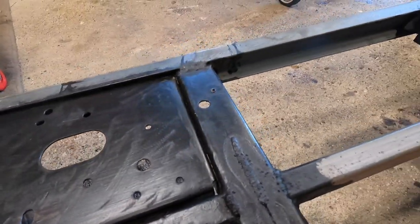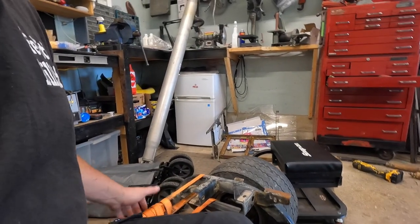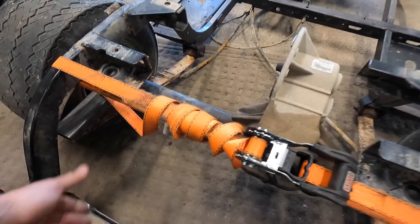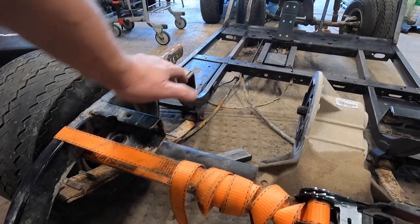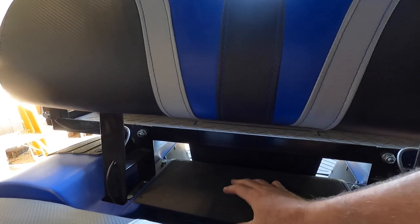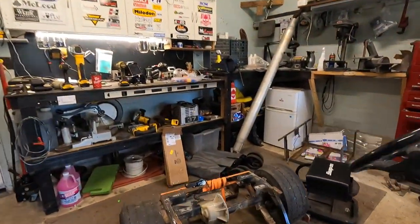I can't weld up that crack yet because I took out the battery box — which is over there and I'm going to rebuild — so that's out right now, that's why it looks so open. I also slammed the rear end down; I cut the leaves off and got my strap in here. She's pretty much going to be on the ground, and then we're going to raise a leaf perch so we get the shock in. We have room — we can come up to about here with a leaf perch and still run a back seat.